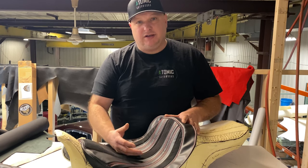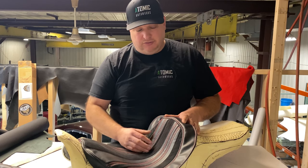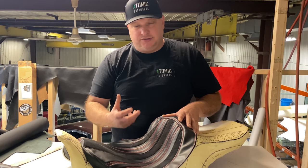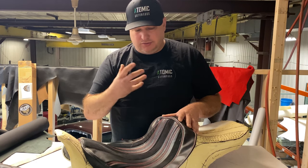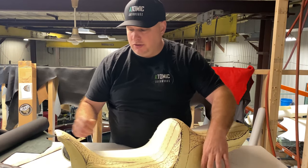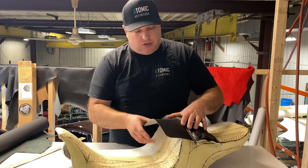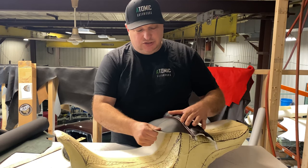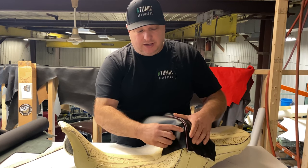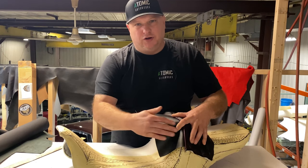If it's a bike you're going to be touring with, doing 10 or 12 hours a day and putting thousands of miles on, the less stitching in your seating area, the better for longevity. If you're more about looking cool and having a nice-looking seat, then stitching is really critical. Top stitches can add a total cool character and style. We don't usually use welting — piping, as people call it — on motorcycles because it can dig into you. Some British and Italian bikes will use this welting, but if it runs down and touches your legs, it will rub them and wear prematurely.